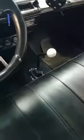It's got its Silver Sport Transmissions 5-speed Tremec installed. It has a new tilt steering column. We didn't end up having to replace the carpet — it did actually fit over the changed transmission hump for a manual setup. It's got pedals now. Before, it didn't even have a gas pedal; he was just pushing on the little rod that came through the firewall. Now he can actually use his gas pedal. Obviously we had to add the clutch because we changed it to a manual trans. We also did speakers in a new package tray in the back. We updated the seatbelts in the back and also the structure for the seatbelts in the front, because they weren't actually bolted to anything, so we made sure that is a safe setup.